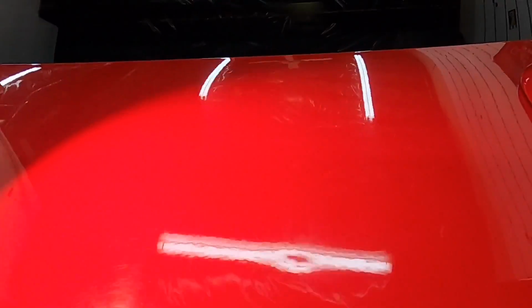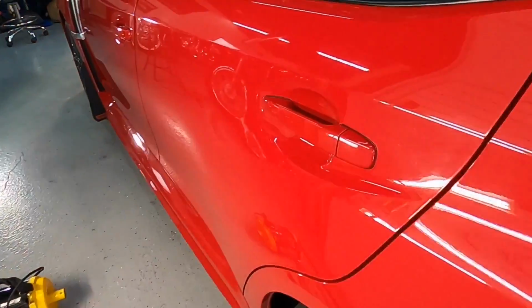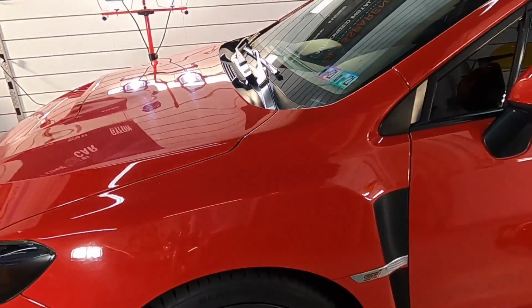There are many fine one-step polishes available, and there are also correction fluids that may be disguised under a different title, maybe a medium polish or a medium grade abrasive. That can also be used effectively in one-step situations. We're going to take a look at some of those today and see which one works best with the right pad to remove imperfections from this type of finish in a crisscross pattern, which is equal to 2 passes. Then we can move along, doing the correction, hardly removing any clear coat at all, and making massive strides when it comes to turning this finish around.